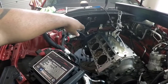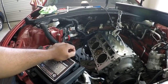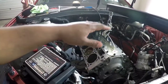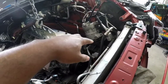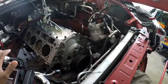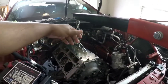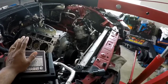As you can see, I have all of my electrical wiring loose and separated from the motor. There were different connections and I didn't want to completely move that out — it's already a headache. I pretty much removed everything else top-end wise, which you saw in the last video. I didn't remove my AC compressor — I removed the two bolts but left it hooked up since the refrigerant is still inside, and I moved it out of the way. I also took the steering column linkage shaft and raised it up so it wouldn't be in the way. I left my radiator in — I believe I should be able to get the motor out with it still there.